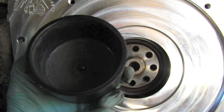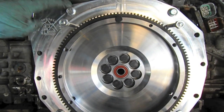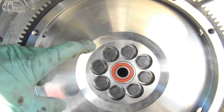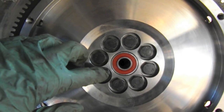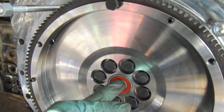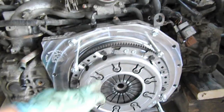If you use a 3-inch plumber's ABS cap you can just slide the seal in and tap it in with a hammer. Then I got the adapter plate mounted — this one's from Rocky Mountain Westy — using four bolts torqued to 40 foot-pounds with red Loctite. The flywheel is mounted at 51 to 55 foot-pounds. Next up I'm going to clean everything up and mount the clutch equipment using the clutch alignment tool and a new LUK clutch.